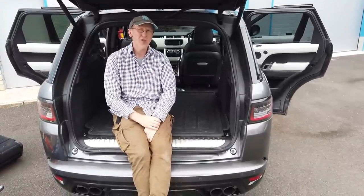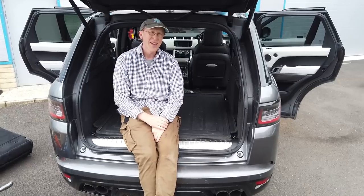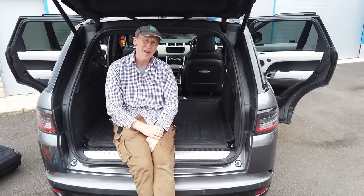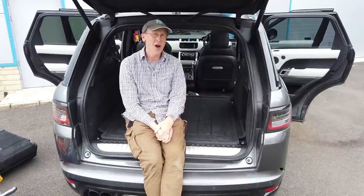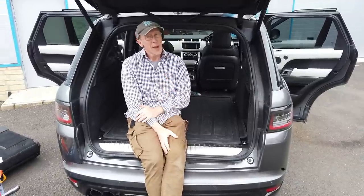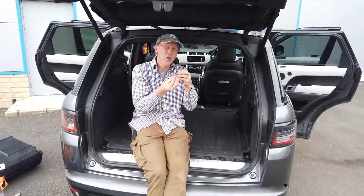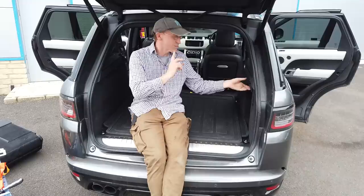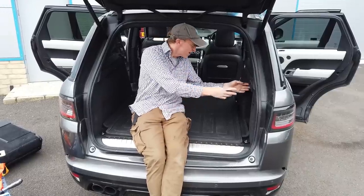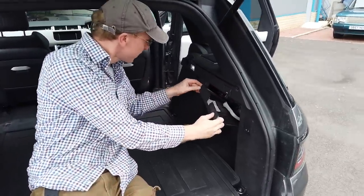Running your car out of petrol — we nearly did that with the Defender the other day — is generally a bad idea. It's even worse on diesels. A lot of this may apply to the diesel as well. On diesels, if you run the pumps dry, the seals use the diesel as lubrication and everything goes wrong, so it's not recommended.